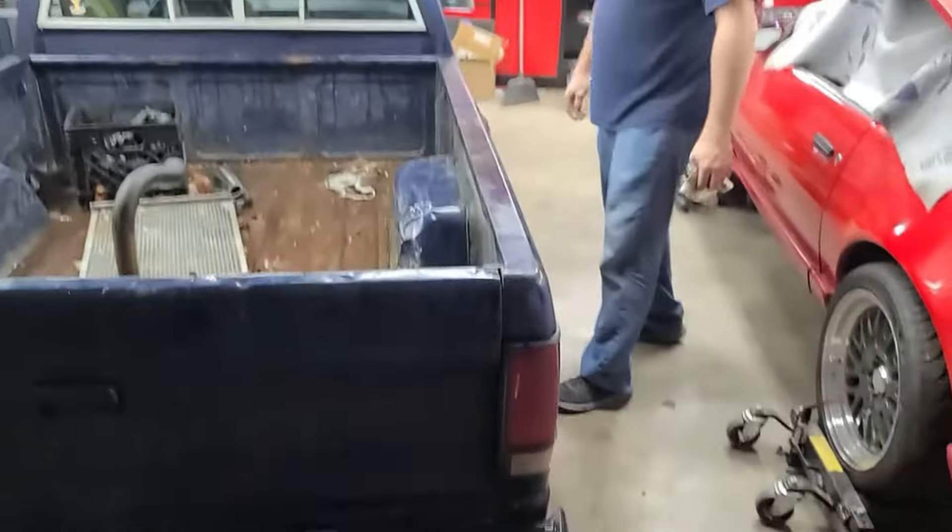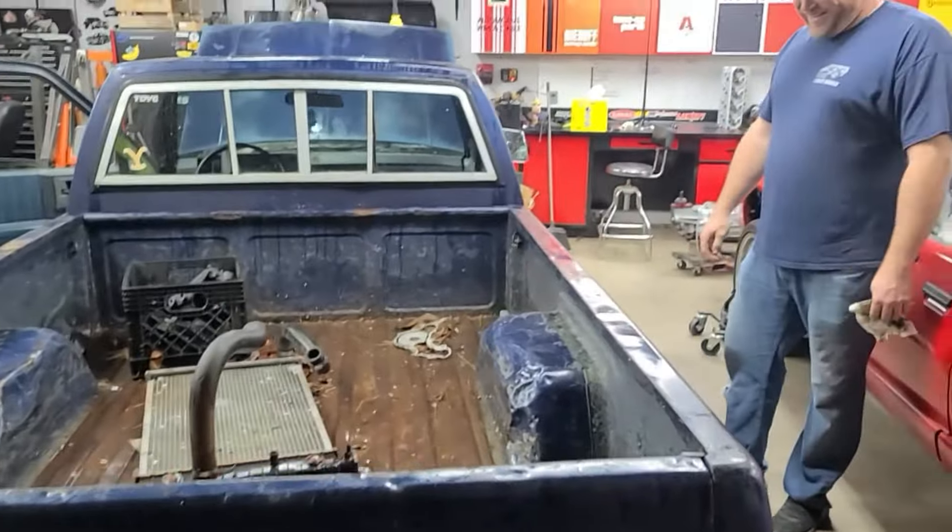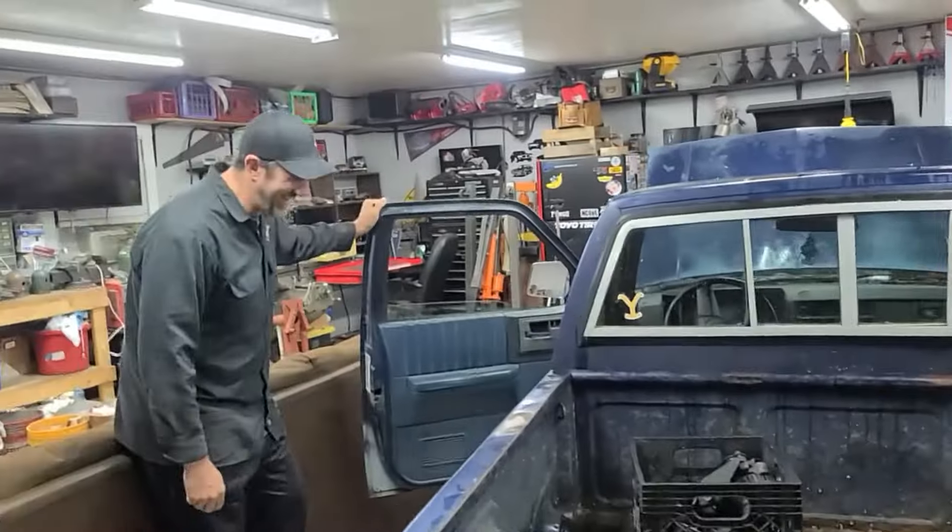It doesn't move — it's almost bending. What they did with the springs is they literally heat them up with a torch until they lose their arch. The coil springs lose a little bit of height when you heat them up. The problem is they lose their spring rate and start riding extremely rough, which is what Joel was joking about earlier.